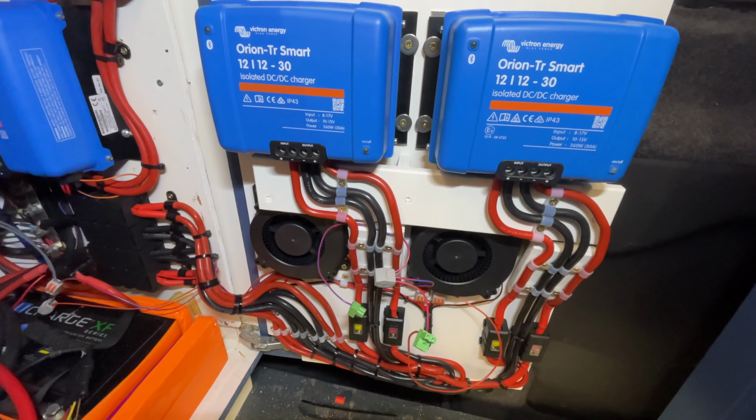Here, after some testing for another video, is a look at my alternator after half an hour under thermal. As you can see, it's only around 70 degrees, which from speaking to people is an acceptable temperature for these units to work at. And looking at the Ford spec sheet, it shows these units working well up to about 104 degrees, so I'm fine with that. That's also a 30 minute test with the van idling, so the worst possible cooling, because it's low revolutions on the engine, so low cooling of the unit and maximum power coming off it.